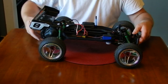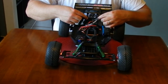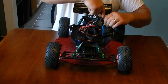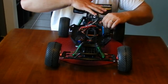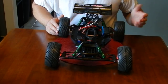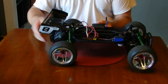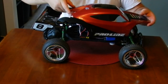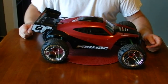I bolted my wing straight through with just four bolts. That can be a little tricky — you want to get your tops on first, drill the tops, try to line them up, drill one, then measure the hole over the same distance. When you get the tops in, tighten them down and adjust the bottom ones so the top of the wing is parallel and flat. I use the Pro-Line high down force wing, which gets really close to the rear flaps of the Badger body.